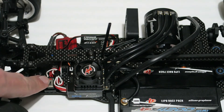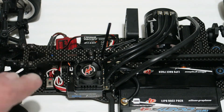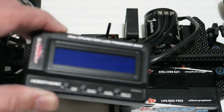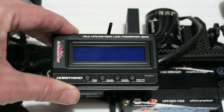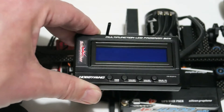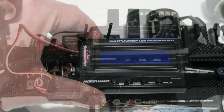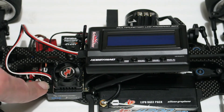There are about 11 parameters you can change via the set button, but the way I prefer to set this up — and I think it's much more effective — is to use HobbyWing's LCD program box. One quick tip: if you've had the box for a while, make sure you've downloaded the most recent firmware from the HobbyWing website, because if it fails to connect to the speed controller it could just be that the firmware is out of date. Connecting the program box is straightforward — use the supplied cable between the program box and the program port, which is conveniently placed on the top of the speed controller.